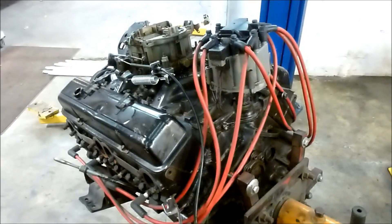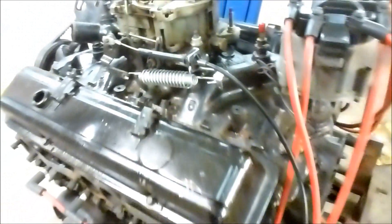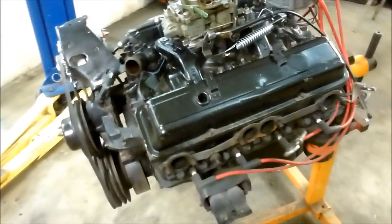A lot of people ask me on engines what's the casting number, the model number. So looking back here, there's an 84 there — I suppose it could be an 84 block. And then here, GM Made in Mexico, 3970010 — I believe that's what that says. So there's some identification numbers for you, and then it's got the four barrel intake stamp numbers, though I don't think that's of any importance. But there it is — the small block Chevy 350 cubic inches, that would be a 5.7 liter engine.